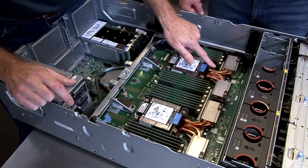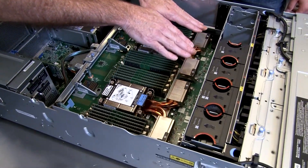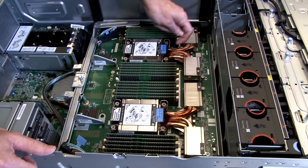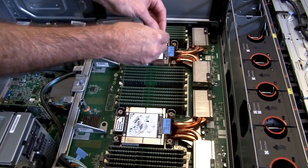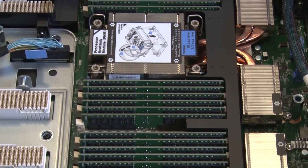The satellite heat sinks are connected via copper tubes that have liquid integrated into the tubing. The heat generated from the processor is drawn away from the central heat sink to the satellite heat sinks to allow additional cooling. We have this for our high-end processors to ensure that even with such a dense configuration, we've got the amount of cooling necessary. With the disk configurations and high-wattage CPUs, plus the incredible number of memory DIMMs, thermal management is critical.